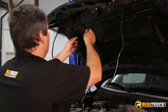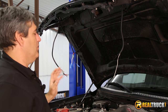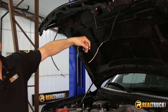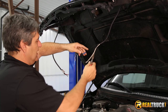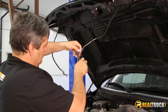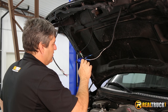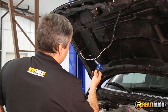I've gone ahead and wired our two outer lights together with butt connectors. Since this is on the outside of the vehicle where it's susceptible to moisture, I recommend heat shrink connectors because they come with a sealer and glue that will seal these up and help keep moisture out. I've got my wiring running to my switch — going to hook that up right here. Once these are connected, we'll heat shrink them down and then wire the main center light into our switch wiring. If you're not used to using a mini torch, use a heat gun or a hairdryer so you don't burn your wires.